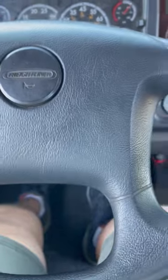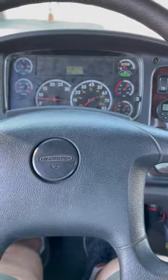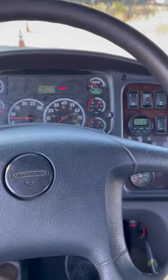Release both brakes — we're checking the service brake now. Let it roll. Working properly. Put it in neutral, apply the brakes. I'm done with the air brake test and I'm waiting for instructions.